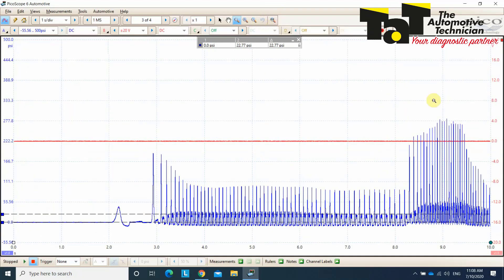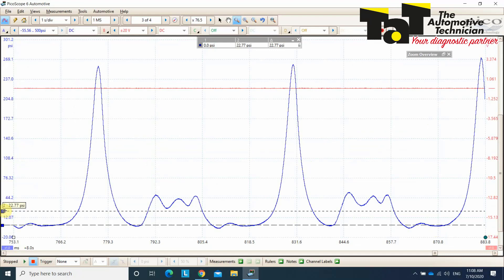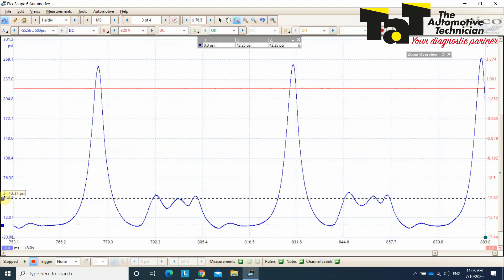So that's only at idle. When we look at where I revved it up, if we truly have an exhaust restriction it's going to get pretty wild. Dragging the cursor up we've achieved closer to 40 PSI — the peak is closer to 50 PSI. So we have 40 to 50 PSI back pressure in the exhaust; with the exhaust valve open the combustion chamber is attached to the exhaust at that point, so this pressure is in the exhaust. We 100% have a massive blockage of the exhaust. It could be anything from an exhaust cam lobe not opening the exhaust valve to a blocked catalytic converter, but I can see events happening here so it definitely has an exhaust restriction.